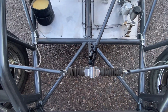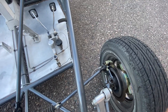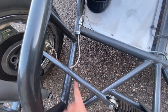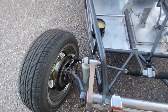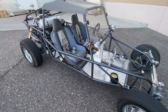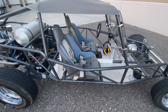When looking at cars like this, pay attention to the rack and pinion — that's what you want. A lot of sand rails have the old steering box setup, which limits wheel travel and creates unequal trailing arm lengths, causing the car to bottom out and mar the frame. With the rack and pinion centered in the car, everything is equally balanced — no frame marring, no bottoming out, and you can add longer trailing arms for mid-travel. This setup is way faster and more reliable than the Polaris Razors or Can-Ams. Polaris even had a $23-$25 million lawsuit settlement around 2018-2019.